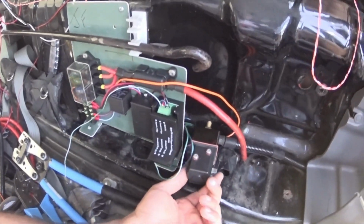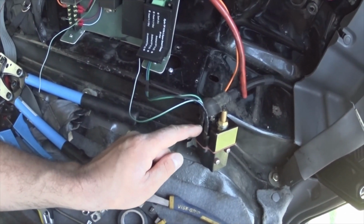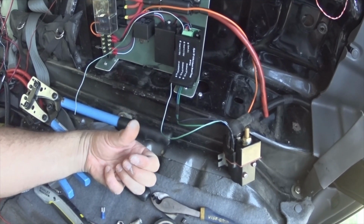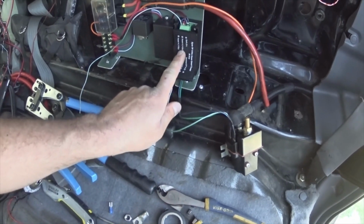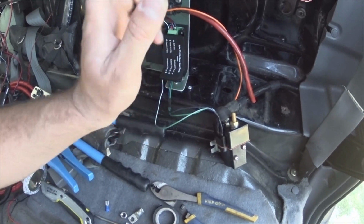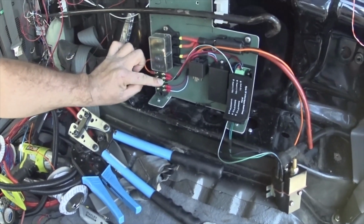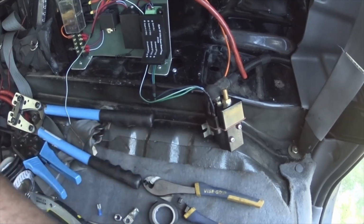So I almost forgot, as I was crimping these on, that's the ground terminal for the trigger coil, I guess you'd call it. So I've got a green coming from this, which is a VSR, that switches it on and off, and I wanted to add either an indicator light or an override switch, because sometimes if you're winching and you're drawing the main battery down, that doesn't get a chance to see what's happening, if you know what I mean. So the main battery goes down below threshold, that then cuts it out, and you haven't got your auxiliary batteries. So we're adding in an override switch through here, just threaded it through there to make the wire run a bit neater, and then we'll bang it on that spare terminal there, and we'll also be able to hotwire that basically onto a live to override it, to close it, to keep it closed.